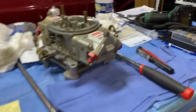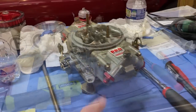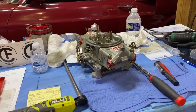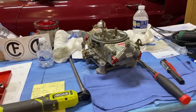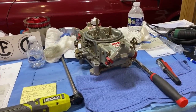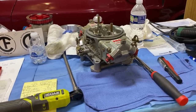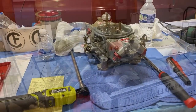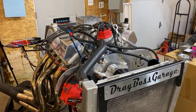I switched to the 120 steel needle and seats because I had been running Q16 and it corroded what was in there — which was a Viton-based needle and seat. Viton is not compatible with alcohol, E85, or probably even Q16. But after I put the steel ones in, I looked in the intake and saw the throttle bores were wet — like it was leaking through the needle and seat. So I put the 120 Viton ones back in and I'll just make it a serviceable item during the season: pull the carb, put new ones in if I have to. I don't want the thing flooding or the needle and seat leaking. Like Warren Johnson said, I just need to put some heat in this thing and torture it a little — see what it does.